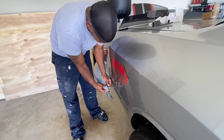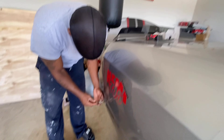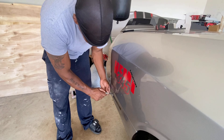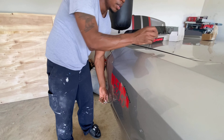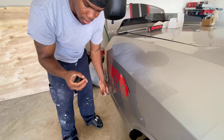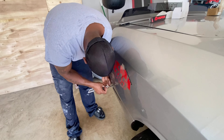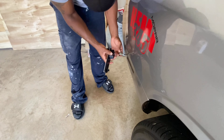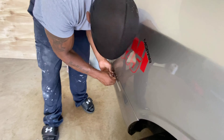So what you're going to do — take this, twist it. It's the old marker light. Then you're going to take the bulb out, just like we did in the headlights for y'all who checked out the headlight video. Then you're going to take the new LED marker light and plug it in where the bulb came out. Plug it in like that, push it back in there, and just pop it in.